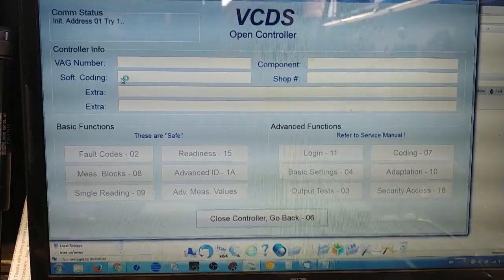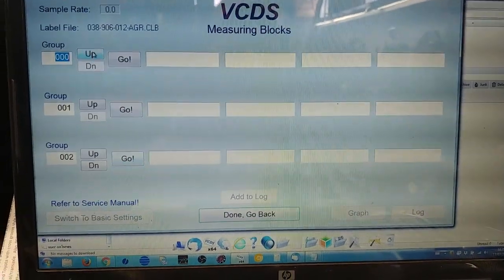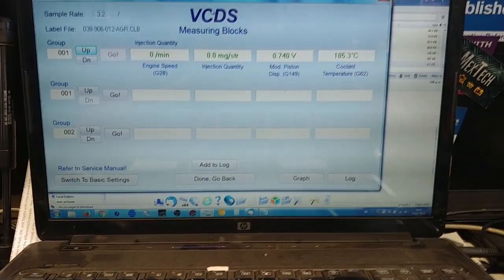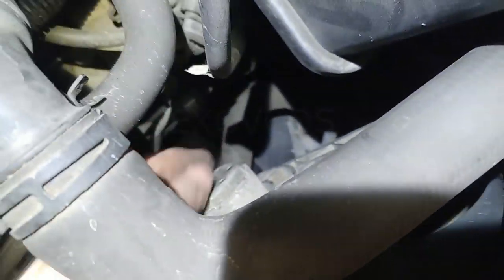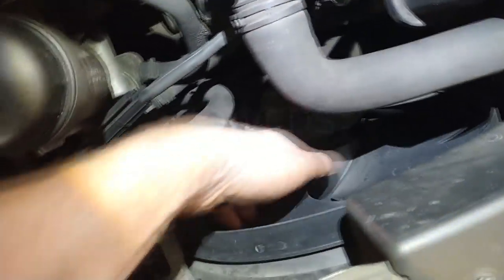This is the TDI that I was just working on that had the coolant flange pop, and I just let it run outside. You can see temperature is at 105, and the radiator hoses are hot on the top, the lower one is cold, and the radiator core is cold — I'll show you. So thermostat is bad on this one. Don't go by the top hose — that will be hot and you'd think the thermostat is open. Follow the hose along — that hose is completely cold.